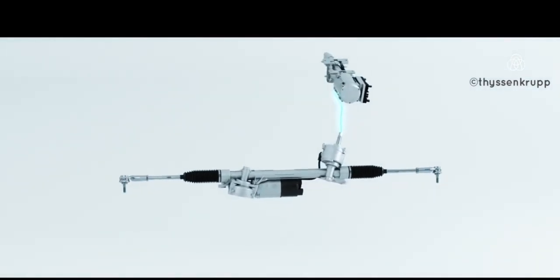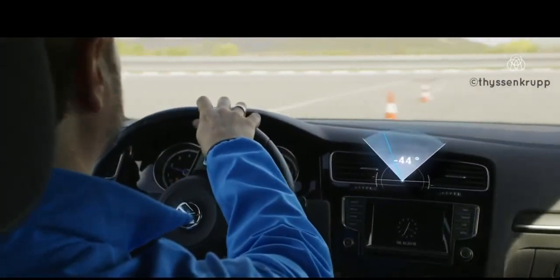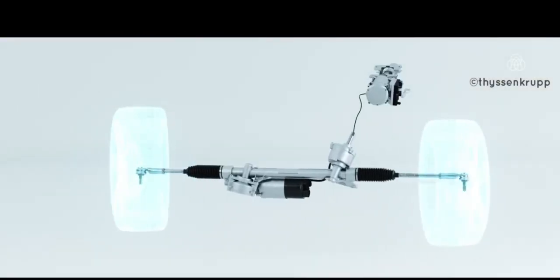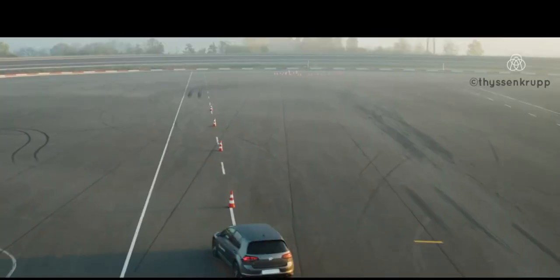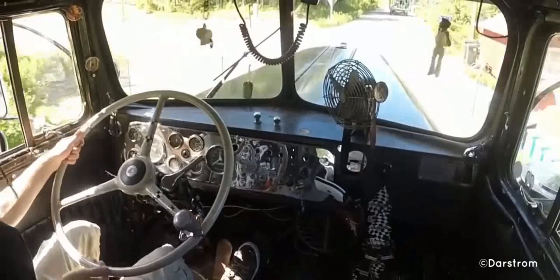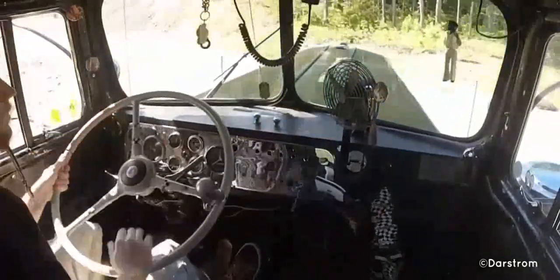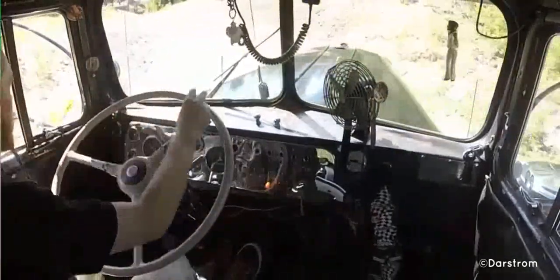The steering has a sensor in it which senses the angle of steering. The data is given to the motor controlling the steering mechanism, which then turns the mechanism and steers the car. So there's no need to put in human effort to move the wheels. You just have to tell it where and how much to move. So why do a million turns of the steering to take a U-turn and waste energy? Just turn a few degrees and you can make a U-turn.